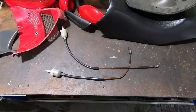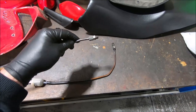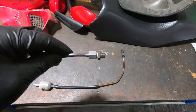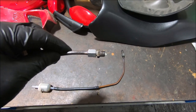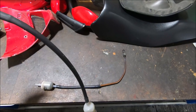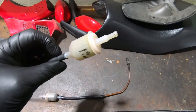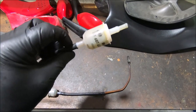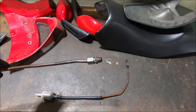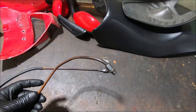These are the exhaust gas probes I use. This is an eighth-inch gas fitting on the end — it's actually tapered on these fittings but the plug is a straight thread in the bike. It's got a piece of special hose on the end that doesn't let hydrocarbons out, and a little Bosch filter just to trap moisture as it goes through. These are actually a Ducati part. I've got a couple — one has a nice big bend in it.